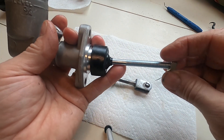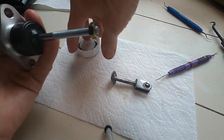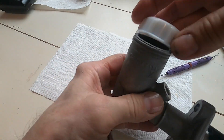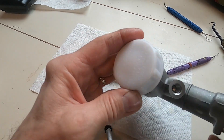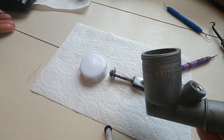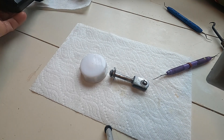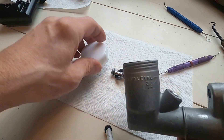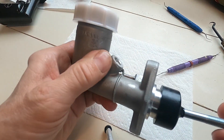That's the nut that comes with it for different applications. The cap is different too — if you've got an old Girling metal cap and you try to put it on this master cylinder it won't fit. Haven't tried it on the Wilwood one yet; maybe it'll be the same. It would be nice to put an original-looking cap on there.